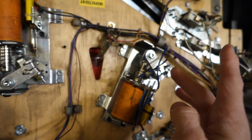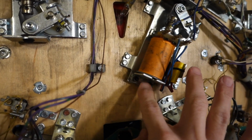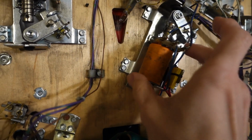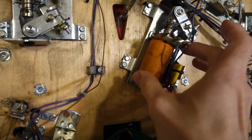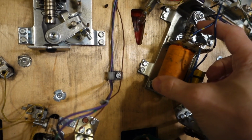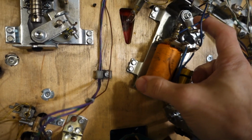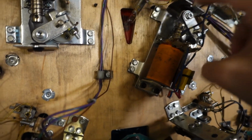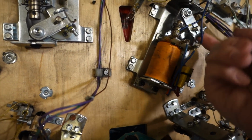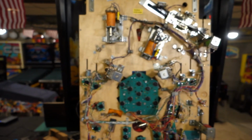So what I'm going to do is we'll take the coil stop off. We'll inspect that. We'll remove the coil. We'll take a look at the sleeve. We're going to replace the sleeve no matter what. They're super cheap. I've got some of these plunger link assemblies in here. And we'll unbolt it from here. We'll pull this out, and we'll also change the bushing. And that'll help quite a bit. I don't have a full flipper rebuild kit because I've kind of got all the parts right here.